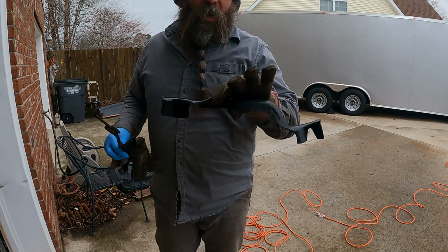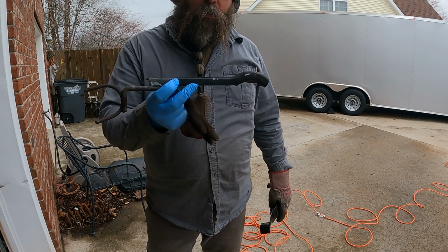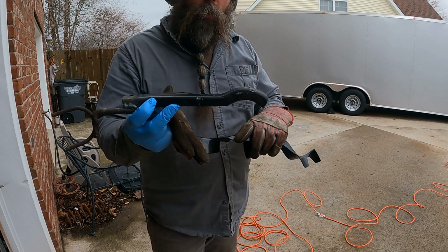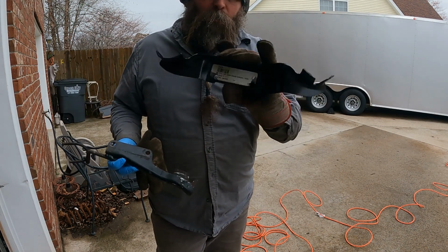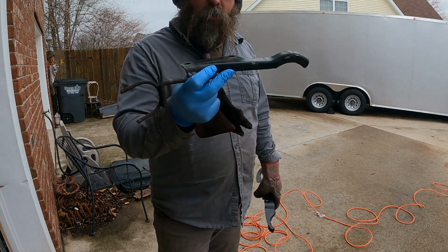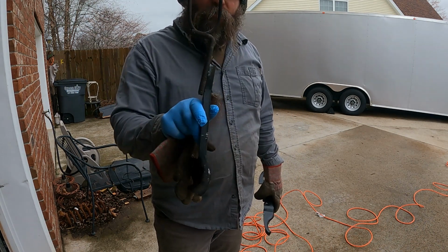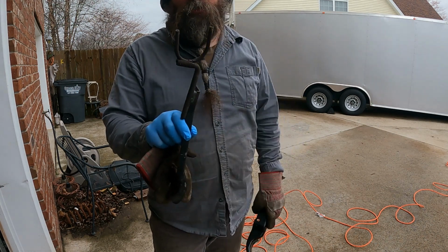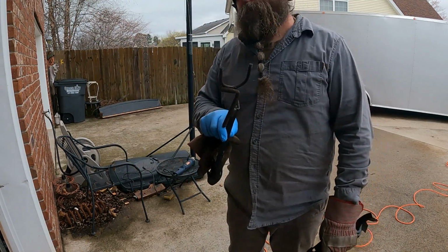So I guess that's for the L82. And the L48 being a single exhaust with a catalytic converter. So a 2 into 1 into 2, and this is true dual exhaust. For the Turbo 400, Turbo 350 uses that 2 into 1 back into 2. It's already been modified, but for a 2-inch exhaust, I got to put a 2.5-inch clamp on there, and then we'll see what's up.